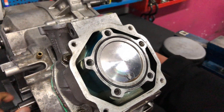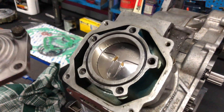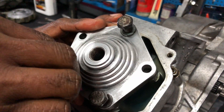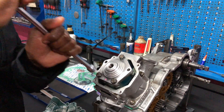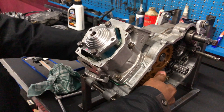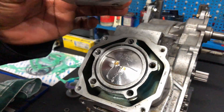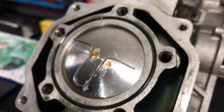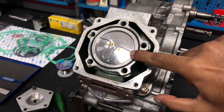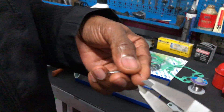Don't send it all the way down, just a little bit — stick it right in the middle. Now you gotta spin the crank. Now we take the head apart again. As you guys can see, it's kind of compressed there — there's a mark where the piston hit the cylinder head. We'll be measuring it now. Our squish goal as I said is 65.